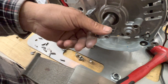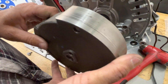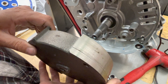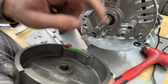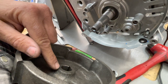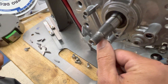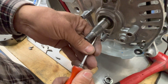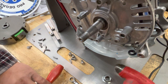You don't even need the key in here and this flywheel will not move. If the car slams the wall and has a sudden stoppage with the tires, it might get this flywheel — that's the only thing that will get it to move. But if you're regular racing and these are pinched together, it's not going to move. With the key in there, it's never moving. It's like your drill press at work — if it has a tapered shaft, you put it in there, lock it together, it's not moving. So here's the key right here, and it didn't take much to get it out.